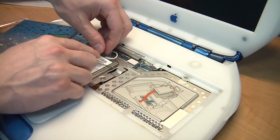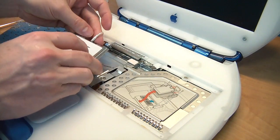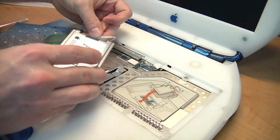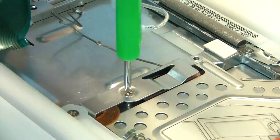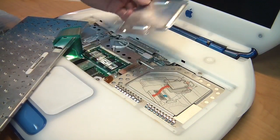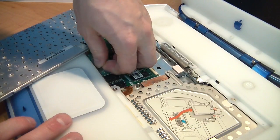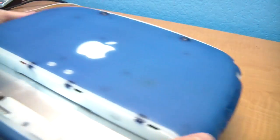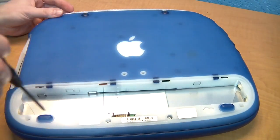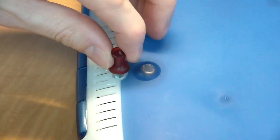Next, you'll remove the airport card and gently pull the antenna cable out. Next, take out the two screws from the memory cover, then remove the cover. Be sure you're keeping track of these screws. Next, pull up on the keyboard connector and remove it. Now flip it back over and remove the two long screws at the top and then the four shorter screws on the bottom. These screws are recessed and you may need a magnet to get them out — same for the four smaller ones.